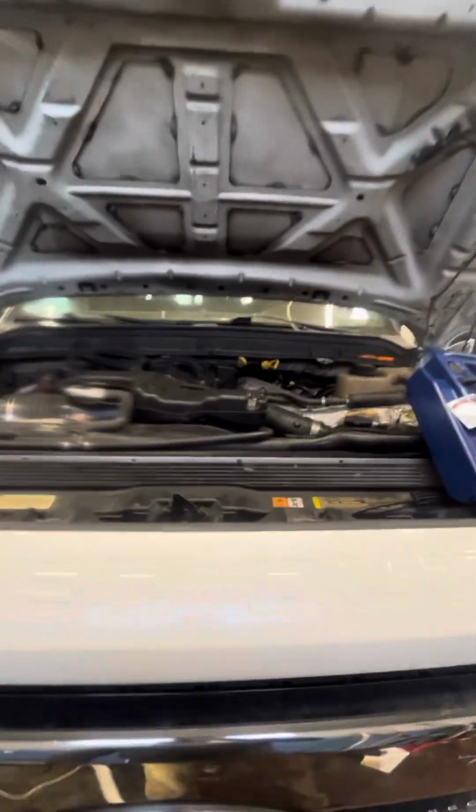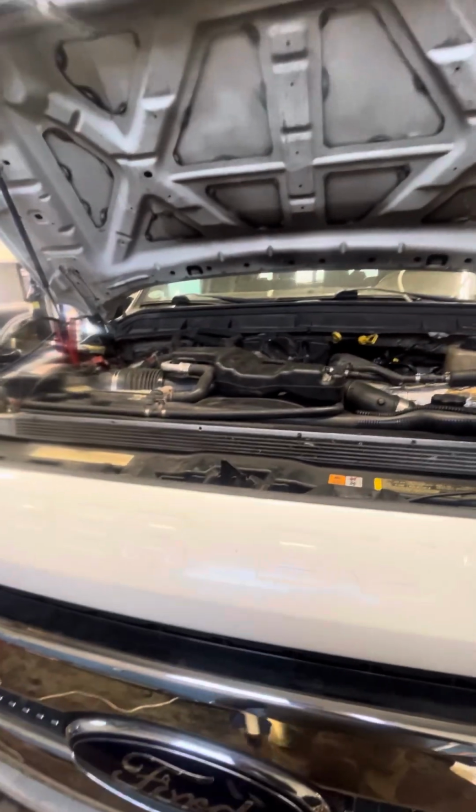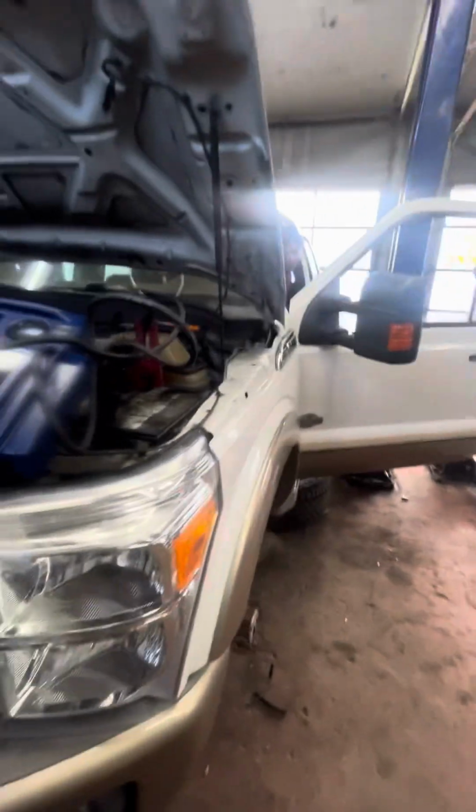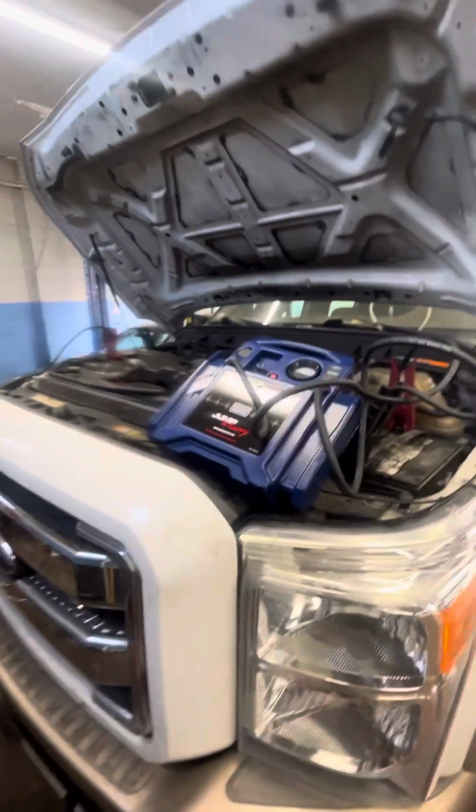So this car, the high pressure fuel pump was replaced. Anytime you have something that has no fuel pressure, especially on the diesel, the first thing I would do is change the fuel filters. So when it came in, the fuel filters were changed. On the high pressure fuel pumps on these, there's a solenoid you can remove. I have an actual old high pressure pump here.